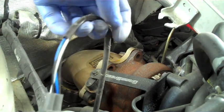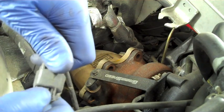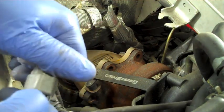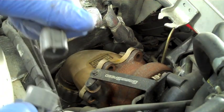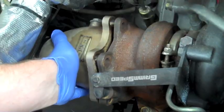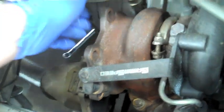Next we are going to locate the O2 sensor wire running from the exhaust manifold. Look for the connector and disconnect this so when uninstalling the exhaust manifold it is much easier, so you do not have to unscrew the O2 sensor from the exhaust housing underneath the car. There is also a bracket connecting the down pipe to the transmission that you will need to undo, and then we are just going to drop the down pipe.